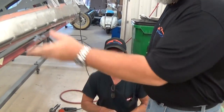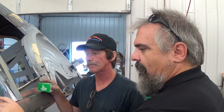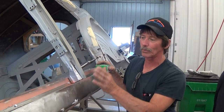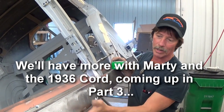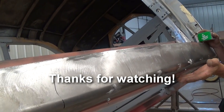Let me introduce you to Marty Newkirk — he's the one doing the bodywork on this CORD. Tell us a little bit about it. The repair that was here was terrible. Someone had already tried to repair it, it was all rusted out, and they put some filler on it. It was just rusted away to nothing basically, so we made a new inner frame rail. Then I took it outside, did all the sandblasting, and made a new rocker panel for this side, because this rocker panel was so destroyed it was beyond repair.